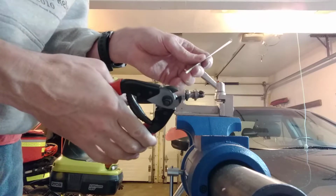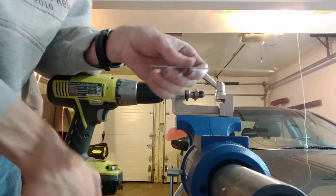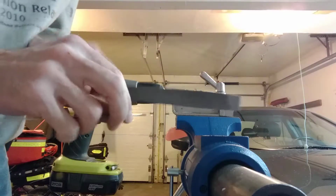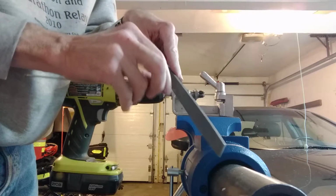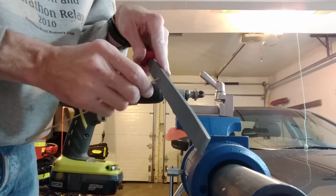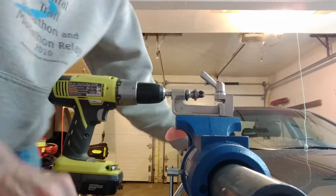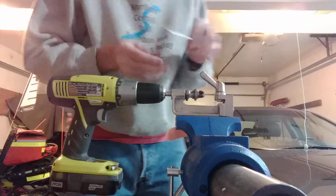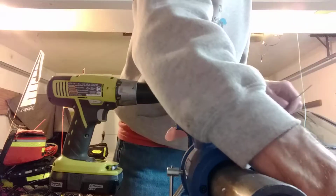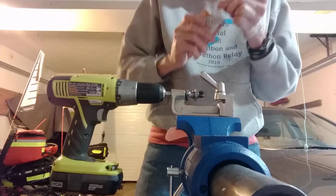I didn't want to use my Park cable cutters for this anymore. And so I've cut them all, well, I cut a whole wheel's worth anyway. What I do then is I file them flat, perpendicular, and then roll and get all the burrs off, because you don't want any burrs when you're putting them into the spoke roller, or things won't work out nicely. So then I've got my Hozan spoke roller set up, and you've got to make sure you have a little drip of cutting oil once in a while on those rollers.